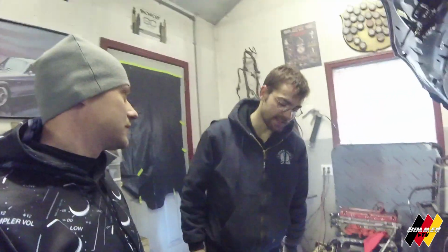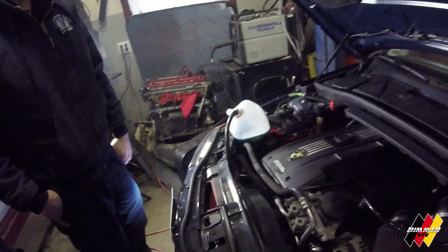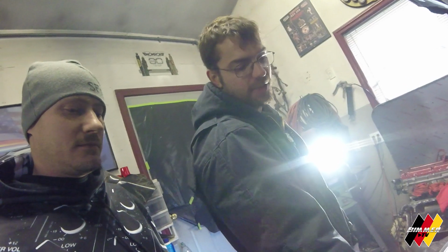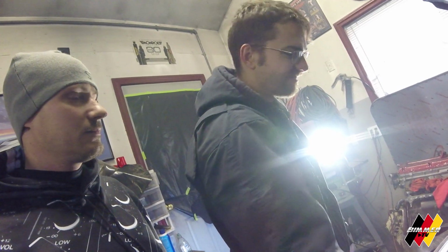Jeff, tell him what we're doing today. Today we're doing an oil filter housing gasket and cooler gasket. Right now I'm just basically draining the coolant from the system, because coolant's going to be running through your oil filter housing, helping cool your oil as well.